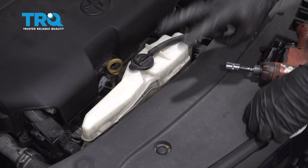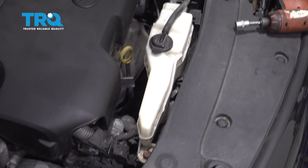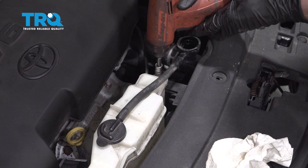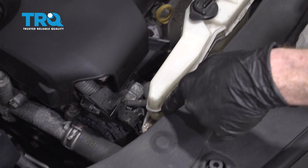From up top inside the engine compartment, let's go ahead and remove our coolant reservoir. To do that, you're going to find two 10 millimeter headed bolts — one on the passenger side and one on the driver's side. Aside from that, you have a hose that goes between. Let's start removing the bolts — take that right out of there, set it aside, and do the same to the other one.